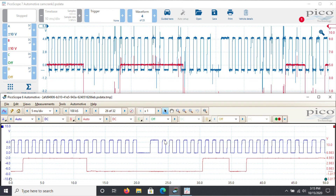Counting on the other capture: one, two, three, four, five, six - six and a half. So six and a half versus nine gives a difference of about two and a half teeth. That's where we are - we are approximately two and a half teeth off on our cam timing. So what we're going to do is take off the front timing belt cover and find out whether the physical timing belt is off or there's an issue with the reluctor wheel.